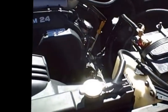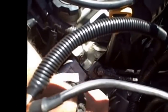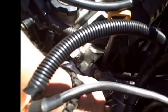I'm sure I have a couple thousand miles left on that, if not tens of thousands. Anyway, so let's talk about the alternator. This mounts up pretty fairly easy. One thing you want to keep in mind is there's going to be a distance between the alternator and your steering shaft right here that you want to be careful of. As this bounces around, it could make contact, but as you can see, I have a good half inch between there, no big deal.